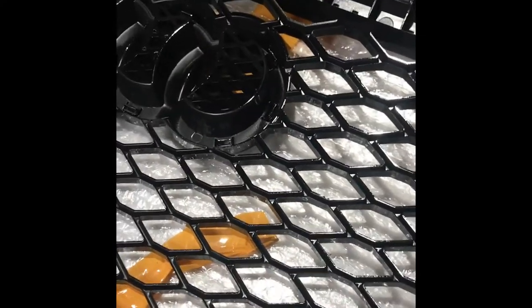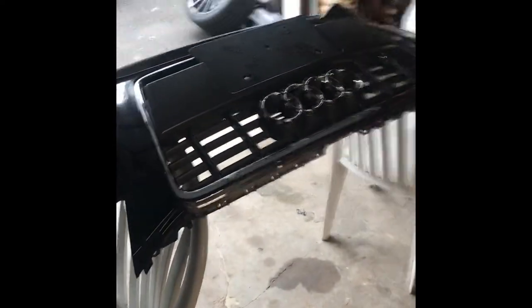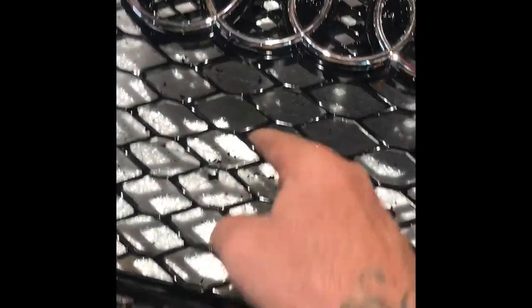We're knocking out these diamonds right here on the grill, then we're gonna sand them real nice being careful not to mar up the gloss finish on the front of the grill. In addition we have the stock bumper - we're dismantling the grill and it's fairly straightforward, you have a number of torx fasteners on both sides. We'll pop this out, polish up the bumper, and install our new grills. The new grill's been dremeled out in five areas and it'll look pretty good. The old bumper is compounded and polished and we'll do a final wax on it before it goes on the car.